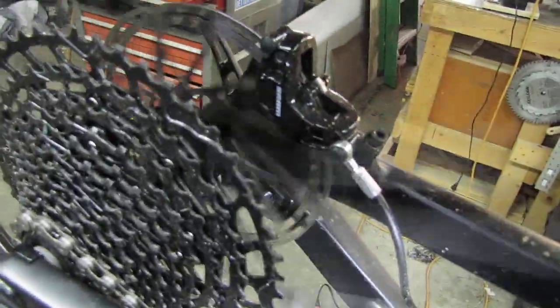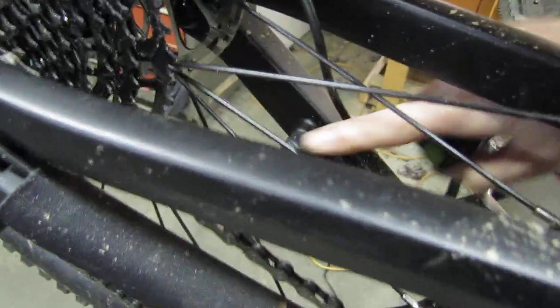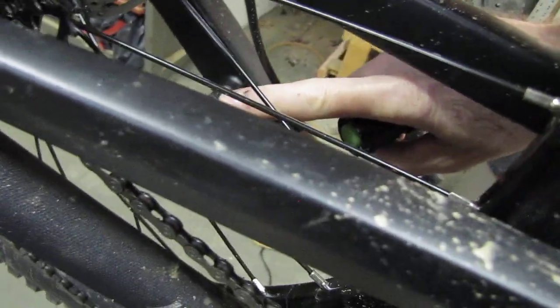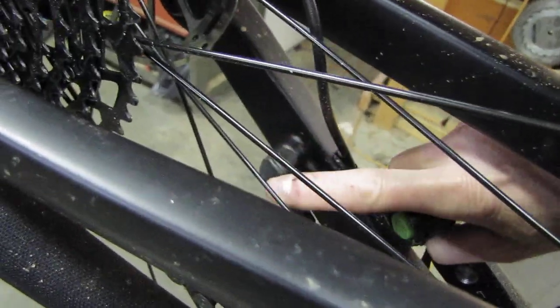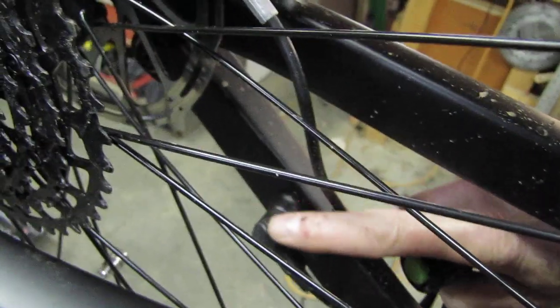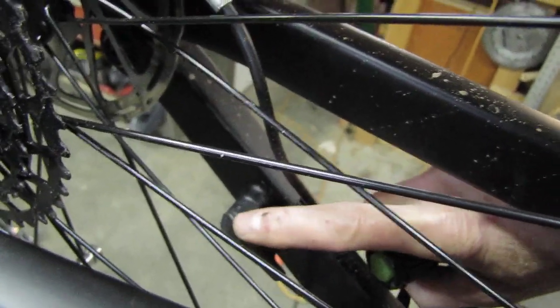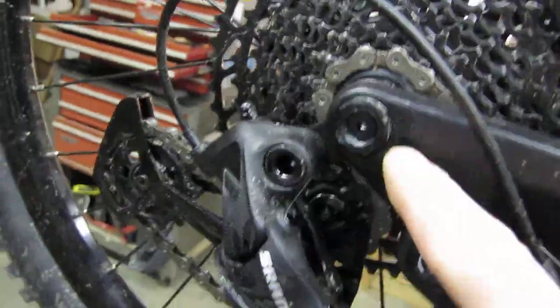Right down there — that's the rubber cap I was talking about. That thing just fell on the floor today. When you push it in it doesn't stay in very hard, so if you want to hold it in place I used weather strip adhesive. You can also use RTV silicone, though sometimes RTV is a little corrosive.